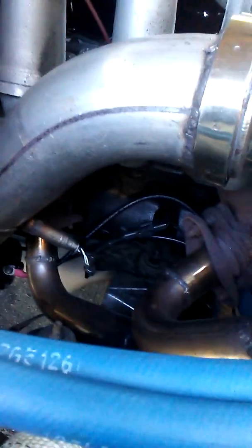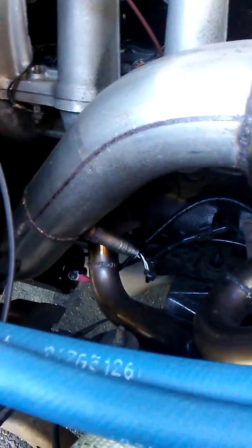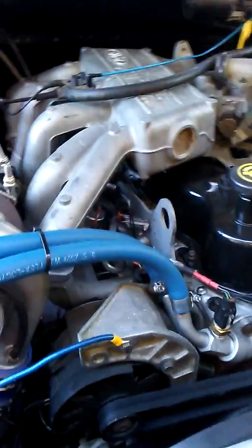So back to the truck a little bit here. As you can see, I have the HD manifolds, which are highly recommended if you're going to turbo your vehicle — they flow considerably better than the single output style. As far as what's going on up top, this is pretty much just a stock engine. I've changed the valve springs to a slightly stiffer spring just because the stock ones were a little weak for my liking.